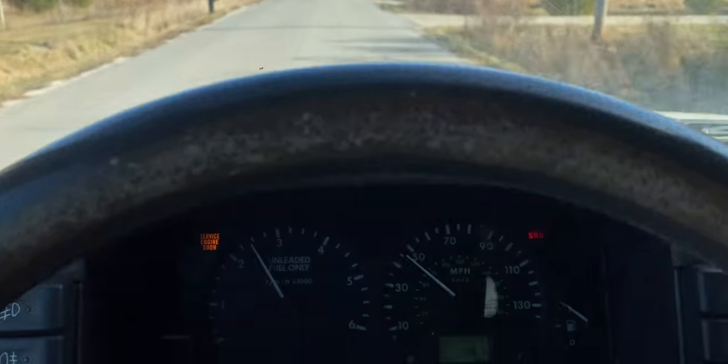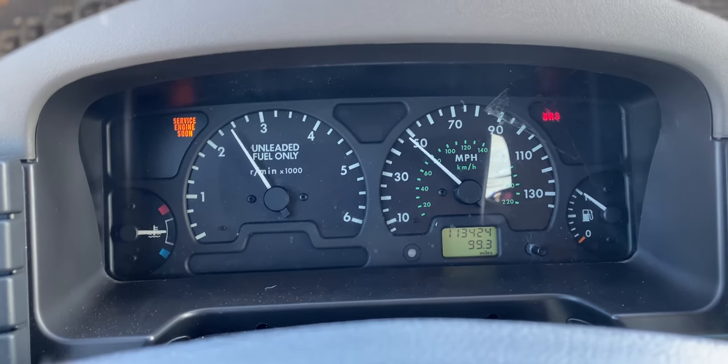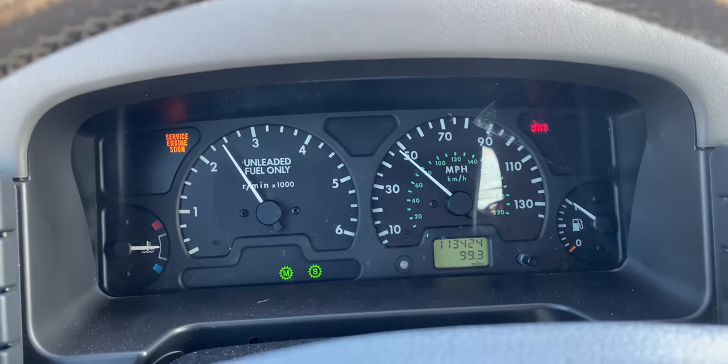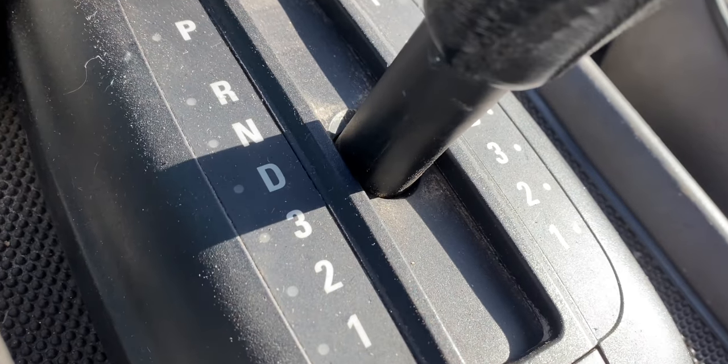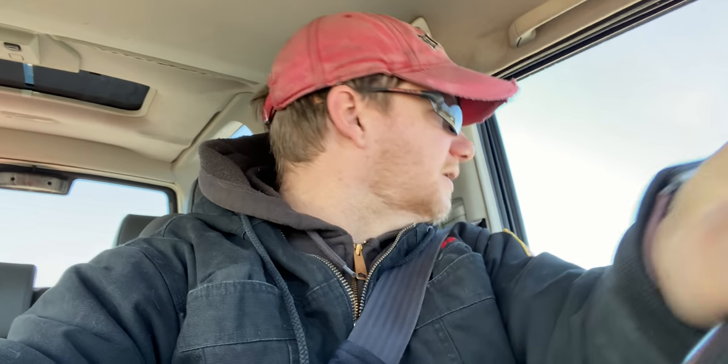I'm driving the Land Rover around right now. The transmission is still stuck in limp mode, so right now I only have third gear. But as long as you're not on the interstate, it's fine. The transmission is blinking the drive light. A few other things I forgot to mention — the first time I drove this straight out of the garage, the steering was very chunky. You would turn in increments of about an eighth of the steering wheel and it would be really chunky turning. That's because both of the U-joints under the hood of the steering had completely rusted.